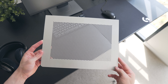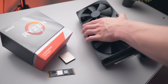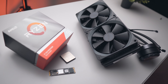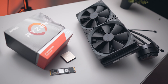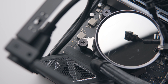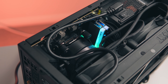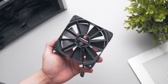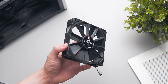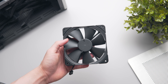For cooling, although AMD officially recommends a 280mm liquid cooler, I'm betting we'll be just fine with a 240mm at least at stock. The one I'm using here is the Kraken X52 from NZXT, and the reason for that is it has rotatable pump leads that allow the tubes to fit a lot easier in the build. For additional case fans, we're using Noctua's Chromax Black NF-F12 static pressure fans. These will help bring air up into the case from the bottom and feed that air to the GPU.